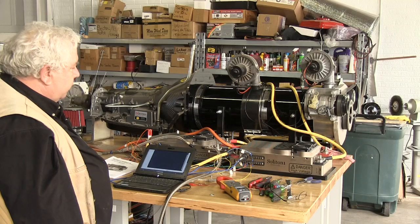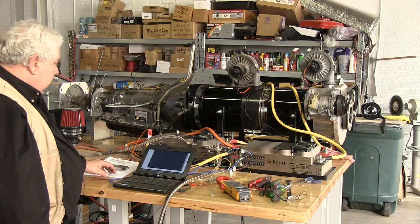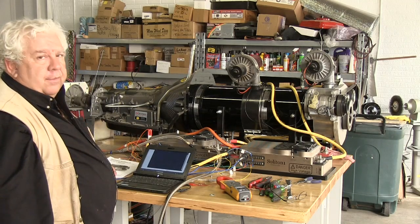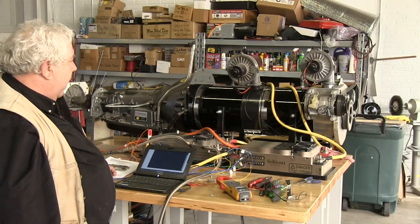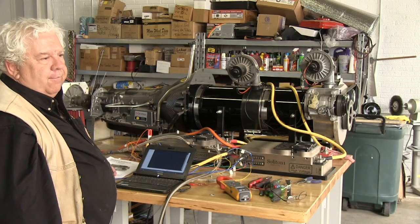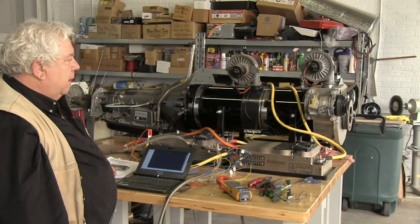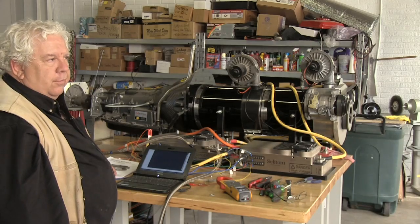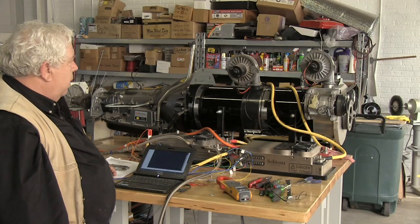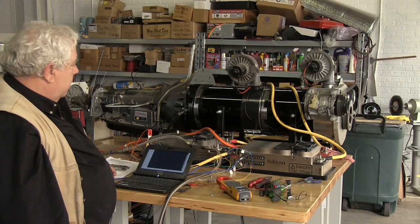We do have a situation here that we have learned from John Hall and Tom Bunka at Hellwig about simply seating our brushes. And this is a very nice way to do that with this test bench. I can just turn this on and walk away and leave it idling for the rest of the day and do that 3 or 4 days. And we have seated in the brushes, and that should dramatically lower the noise impact and get all that working pretty well. And so we'll probably just let that run for a while to see what that looks like.